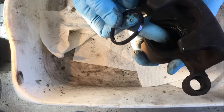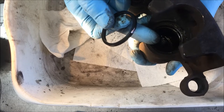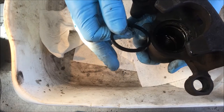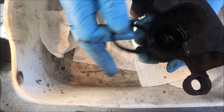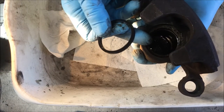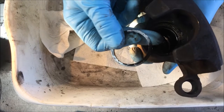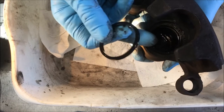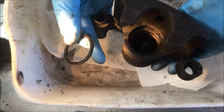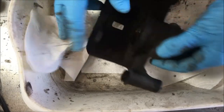Here's that seal right there. You'll know if the piston isn't working because your brakes will get really really hot. If you smell a brake smell and it smells hot when you finish or while you're driving, stop and touch each hubcap area. If one wheel is hot, it's likely the piston is stuck. That is an urgent repair - the slides need to be working, but if that piston is stuck, do not continue to drive that car. Take it apart and recondition it or get a new one.